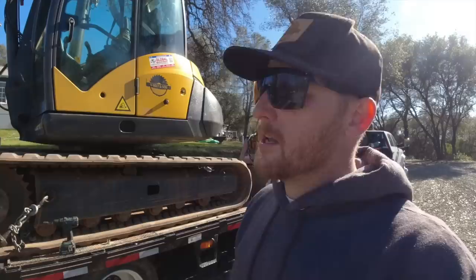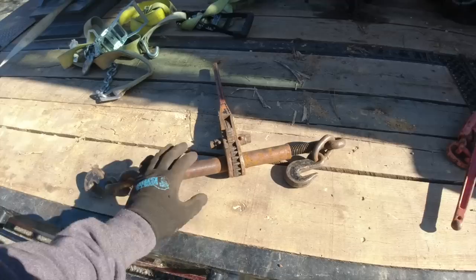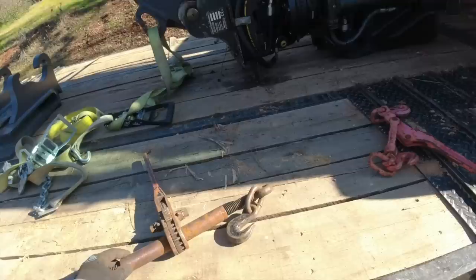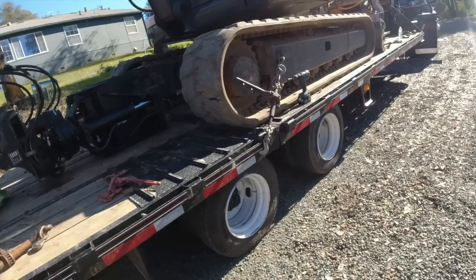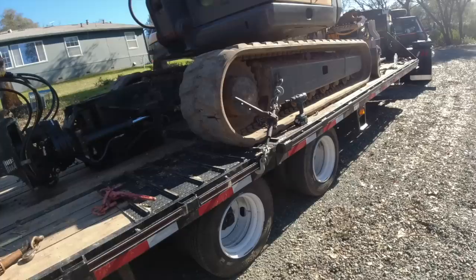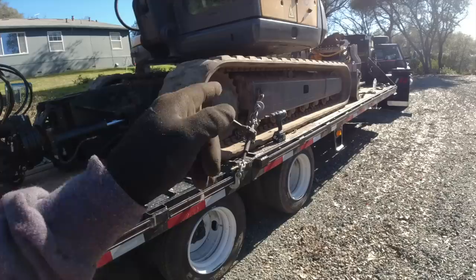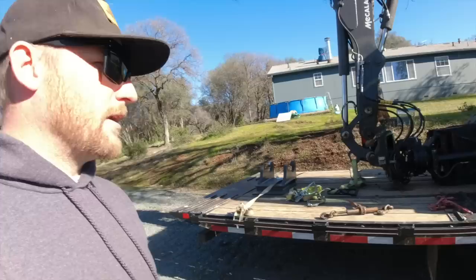I got the speed binders on this trailer and the little buddy, and then I run the ratchet tie-downs on the rest. I'm going to have to get up another set of the speeds for the 40K which I'm picking up this Sunday. I'm going to try getting this video out before that trailer shows up. You can consider those a modified conventional ratchet binder - these ones, they're just no. Logging truck - that's the only place I see purpose for those. Some guys say they're a lot faster with those, some guys say they're faster with these. I would put money on that I could do it just as fast with that. You gotta have a drill gun and stuff, but who doesn't have a drill gun anymore? Those things are cheaper than a chain binder. Speed binders are slightly more expensive than the rest, but I think you're getting a better bang for your buck. And above all, that thing is way safer than the snap binder. You'd be pretty hard pressed to get hurt by one of those. At the end of the day I'm going to vote for the speed binders - nice, simple, no way around it.